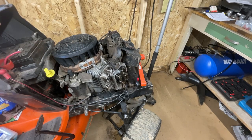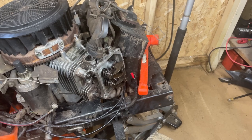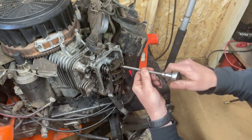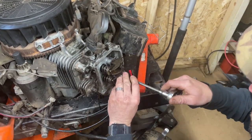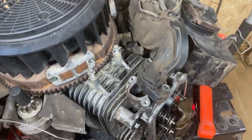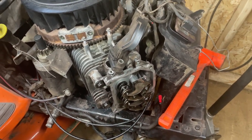I just wanted to show you what works for me. This could be four to six thousandths, so we're going to set it right in the middle at five thousandths on the intake and the exhaust. We've got our valves adjusted. We're going to throw our new rings on the intake side here — it comes with your kit — and we're going to get this valve cover back on here and tidy this up.